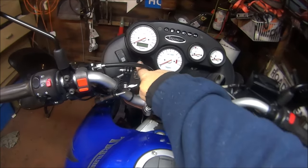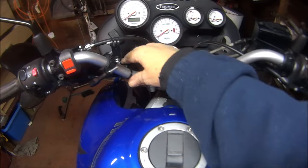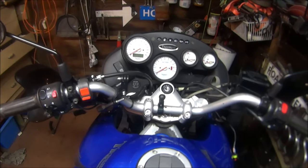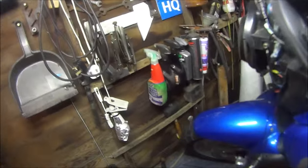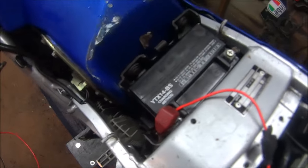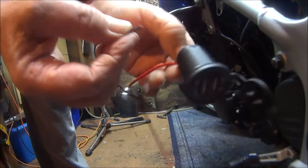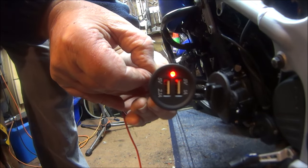I don't know if you can see but that's in my line of sight — you can see that clearly. Just put a zip tie around those to pull them back a bit. Very nicely. Perfect. One down, two to go. We've got all the holes drilled. Now for the wiring: I've connected an earth wire to this little bolt here and connected this wire to the live on the battery, but that's not where I'm going to keep it — I'm just checking that it's a good earth. Hold that red wire onto the positive terminal, put this onto the negative. Yep, so we've got a good earth there.